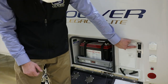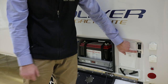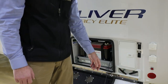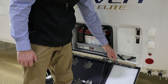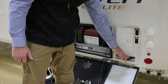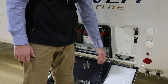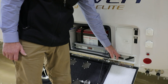To the right, you'll also notice the jack switches — you've got your street-side and curbside jacks, which are the rear jacks. They operate the same way based on the movement of the camper. Below that, you'll notice your black and gray tank valves — this is the waste system for draining. When you're ready to drain, make sure your waste hose is hooked up. We typically recommend pulling the black tank first, then the gray to help wash out the waste pipe. With this model having the compost toilet, the black tank would not typically be used — it's just set up in case you ever want to go back to a standard toilet.